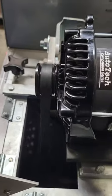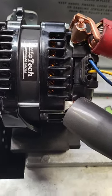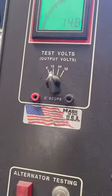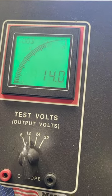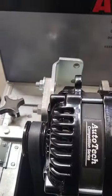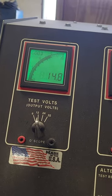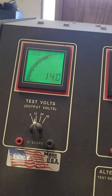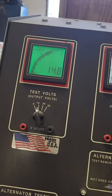Big 3 — that's why we'll put instructions inside of the box. Big 3 is a critical part of your car audio. Without your Big 3 done properly, you will not see the proper voltage, as you're seeing now because I just pulled the ground terminal off. Adding proper ground gets you back to where you need to be; not having proper ground drops you off. Big difference when you add proper ground and what you see on your volt meter.